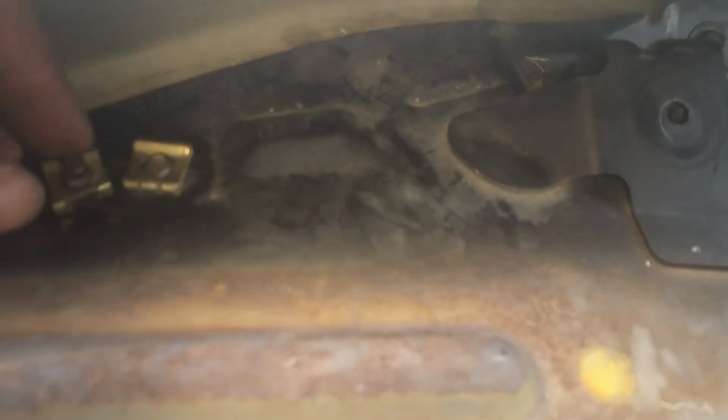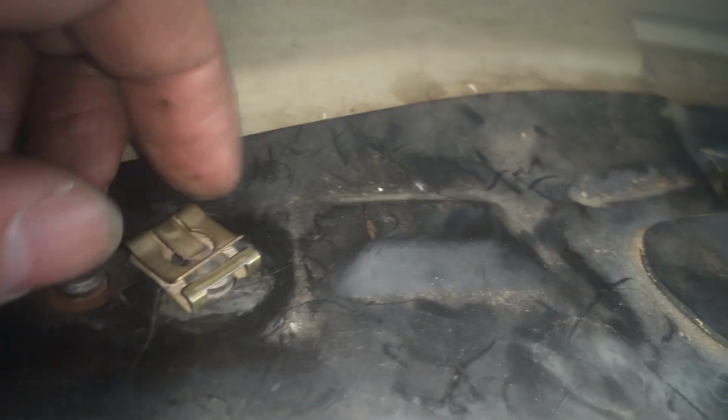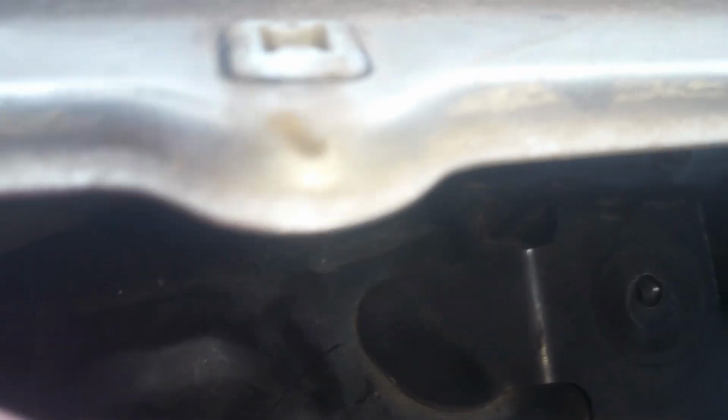Okay, so we just laid that computer back out of the way. Now we're going to work on getting our 10 millimeters out. So we got all these to get. It's really not that difficult. I think while we're at it, this one here, you just take a screwdriver and push these clips. You lift up. See the tab right there? You lift up right there and just push that off. Same way, screwdriver works. And there's those. And just put those aside so you don't lose those. They just clip that auxiliary pump into place, and see now it can just drop down.